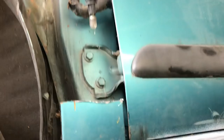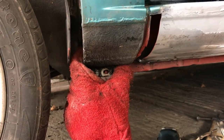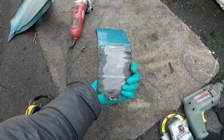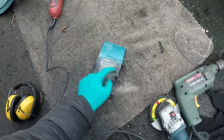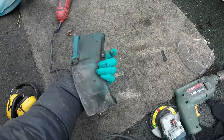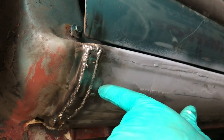You can just use it to double check the profile and it's pretty good. You've got some flexibility - if you really needed to, you could space that out or reshape the bottom edge of the wing. All in all I'm pretty happy with that. I was going to make and fabricate a strip but it occurred to me that I've already got the right profile in the bottom of this wing, so I'm just going to use that - that'll save me a lot of time. I was wanting to use the bit with the deepest profile but it's a bit crusty, so instead I'm going to take this other bit and put a bigger fold in the top when I weld it in the car. That bit is now welded in.